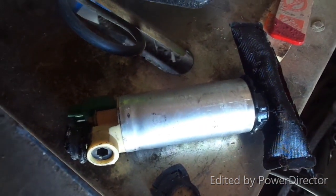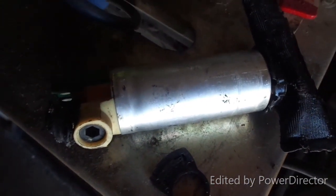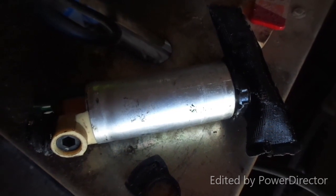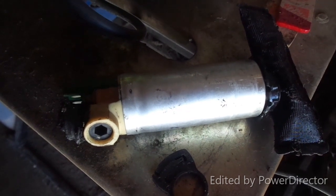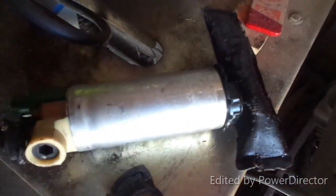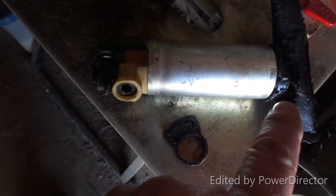Maybe that was the fuel delivery issue on that truck, but the 454 is out and it's not going back in. I've got that small block 400 going in there. I did put an aftermarket camshaft in it, so I don't know how that would work with the factory 454 computer and throttle body — so I'm just going with the original plan: put the 400 in with a carburetor. The reason I took this pump out is I want to put an extension tube where it connects to the pickup unit — just a little piece of copper. I bought a compression fitting coupler to connect it up.